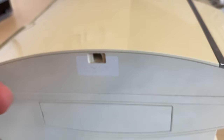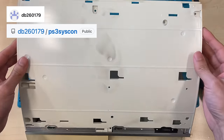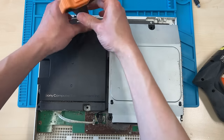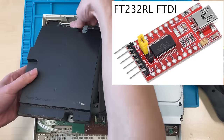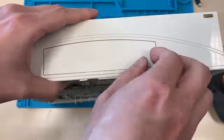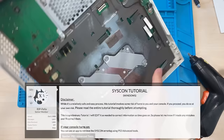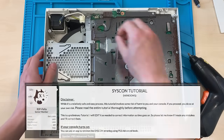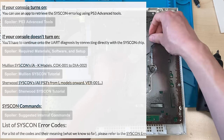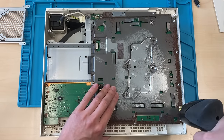It simply means something is wrong during the boot process. To make sense of the flashing yellow LED light, we need some help from syscon — a very useful diagnostic tool that everyone can use, now thanks to this guy. To extract the syscon error log, we need to take apart the PS3 and attach a tiny chip called TTL to the motherboard to send commands and extract the error log. If you are not familiar with PS3 syscon, I recommend you read this amazing tutorial written by Felix — it is very comprehensive, covering both cases where your console can or cannot be turned on.